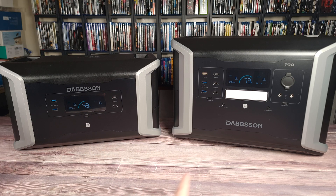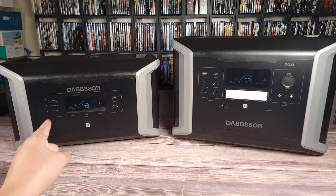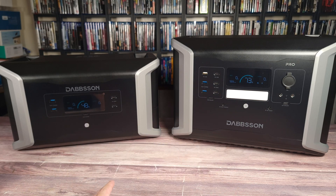When it comes to charging, this has a 1800 watt AC input which can charge from 0 to 80% in only 42 minutes — definitely a very quick charging speed. When it comes to solar, this can take 1200 watts. A cool thing about this setup is the expansion battery can also charge on its own with solar, and it also has a 1200 watt solar charging input. So if you connect both of these to solar, you can charge with a total of 2400 watts.